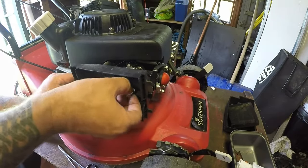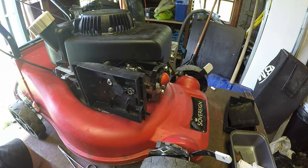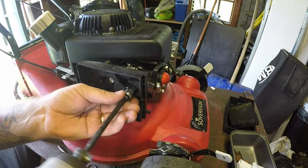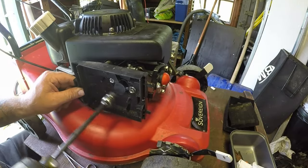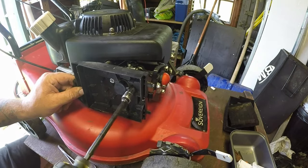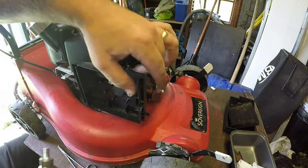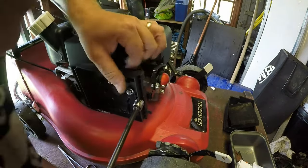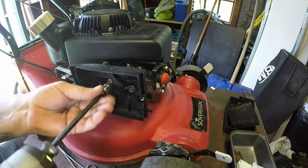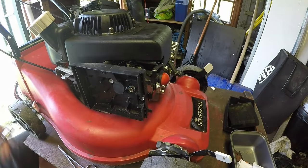And you just loosely nip up those bolts with your socket or whatever you've got to hand. That's one. Two. In fact, I'm going to slacken that off, because I like to get that third one in first, which is your little 10mm. That goes right up here, because that's the one that's awkward to line up the most. Once that one's in place, put the other ones in, like so.